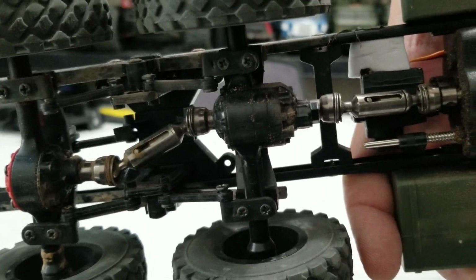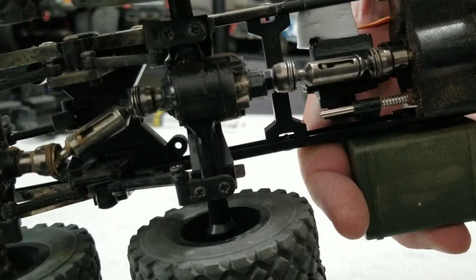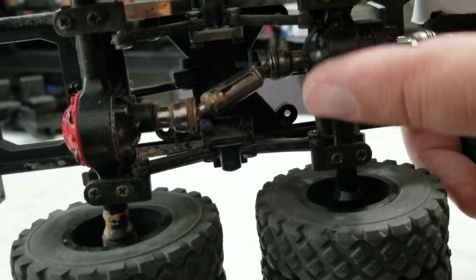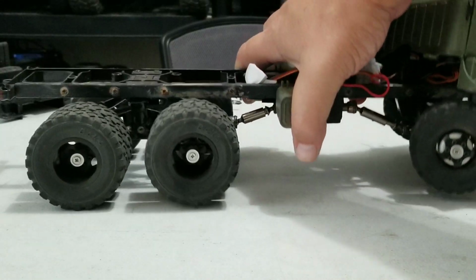As you could tell, it's that upgraded center axle. It's got a bypass through it, so it doesn't have 2 shafts on the ring gear. There aren't the 2 pinions coming out of here anymore like the old school style. This one actually has just 1 shaft going through it and a bypass going to the rear. That eliminates your wheel hopping.